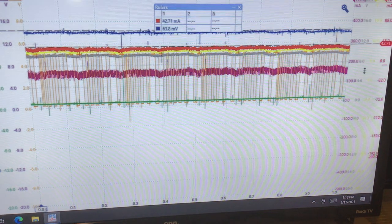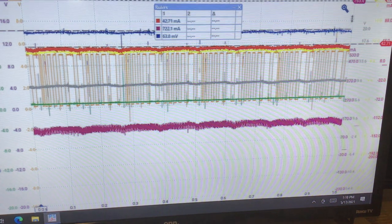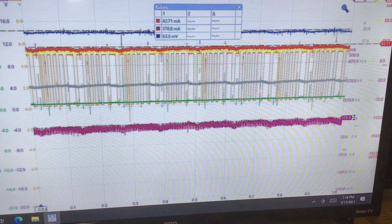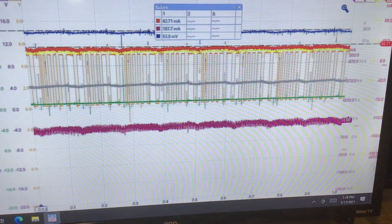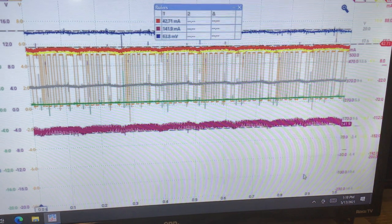The burgundy would be the sum total of those. So let's look at that and see if we're fairly close. As I said, it won't be hair splitting, but the burgundy current, which is current at the PCM at E7, is about 176. If we added 64 and 43, we wouldn't be exactly 176 because there's a zeroing factor which I didn't base it on. If I go to the bottom here, you get into 150, but anyway, I know that that's pretty much the current flowing through both those relays, the PGI main and the ignition coil relay.